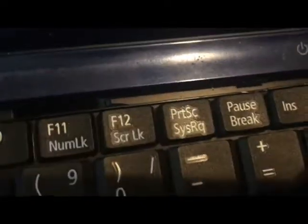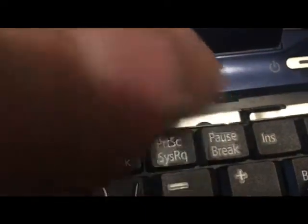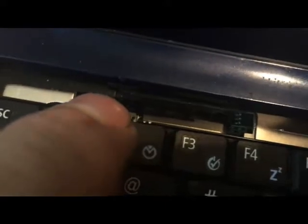and you need to push in that. There's that clip, and that clip. They're not really clips, they're pushing things. So when the keyboard is in, you push that in and start lifting up on the keyboard. And then you come over and you push in this one and keep lifting. And then you come over and push that one and the keyboard will come out.